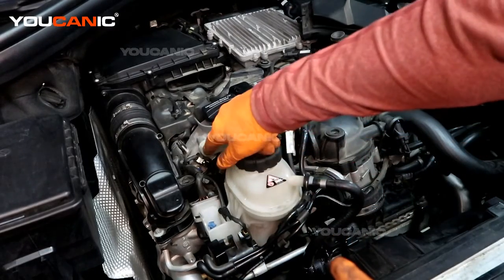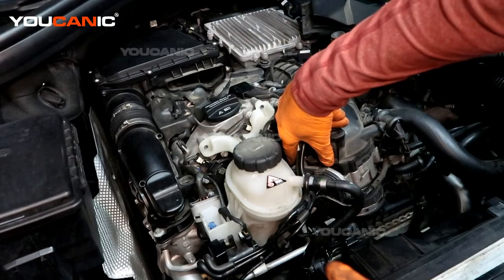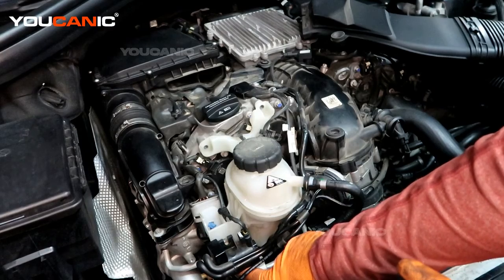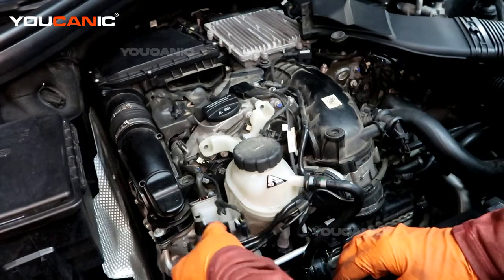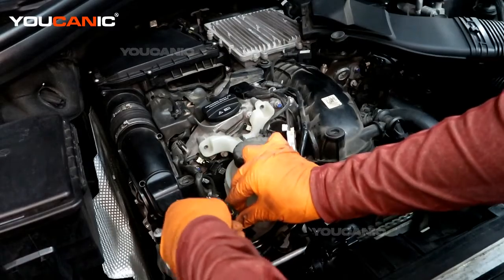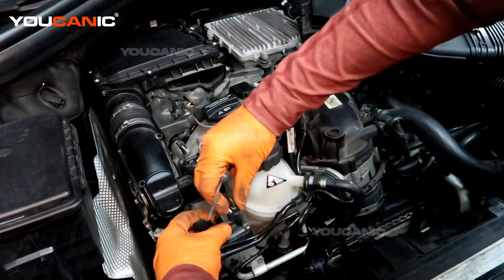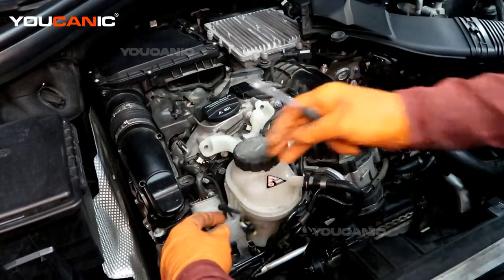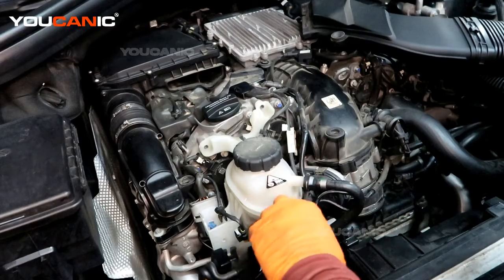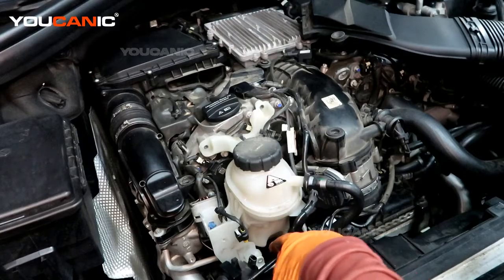Here are two E10s that you remove. Right down in here is a T25 screw to be removed. There's a T25 right here to be removed, and straight below it is a T25 that you just need to loosen a little bit so you can pull up and remove this sensor. These are vacuum lines that go to the turbos and such, so we want to be careful with them and not break them.